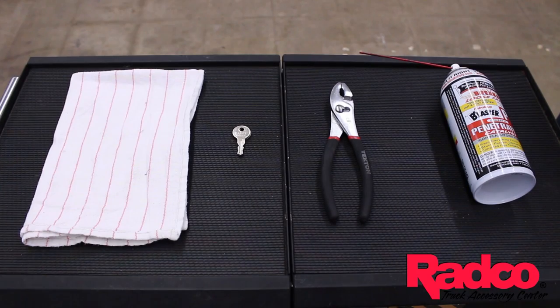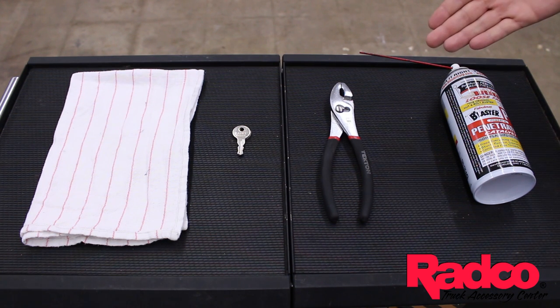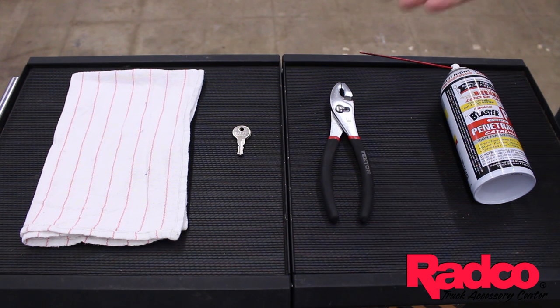Some tools that you're going to need is a penetrating lubricant. We've got PB Blaster here, which works really well for freeing up T-handles. You can use WD-40. Something we've noticed, though, is that once it cleans out the handle, you'll still want to use some form of dielectric grease because it tends to attract more dirt particles in there after using it. We've got channel locks or pliers, a couple sets of keys, and a towel,